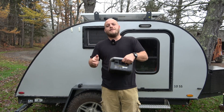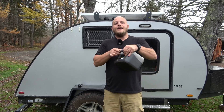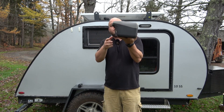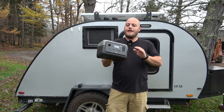The rear handle is dual purpose — it provides a buffer for the inset fan so that if you push this up against a wall, air can still circulate when the system needs to cool. Since the two rear charging plugs are in the back, it also gives a little strain relief on those plugs so when you shove it into a cabinet you're not bending the prongs.